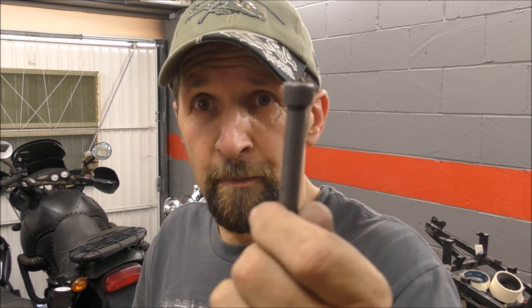Use some common sense. Imagine you've got a busted stud on your cylinder head, right? How many times do you take off that exhaust, and that little tiny piece of thread that holds your exhaust on corrodes, it heat cycles, hot, cold, hot, cold, so many times it gets brittle, snap. And you've got half an inch of it sticking out, you can't get hold of it with much. What about getting a big socket cap bolt, a mild steel one?